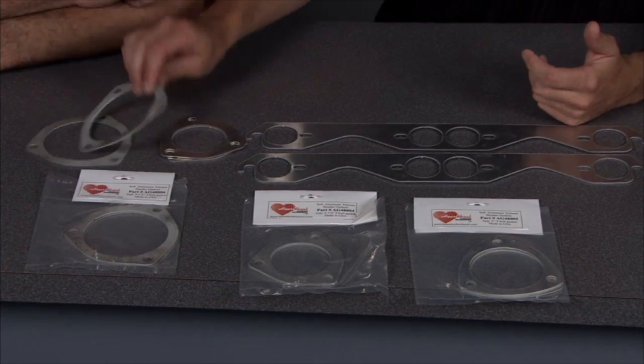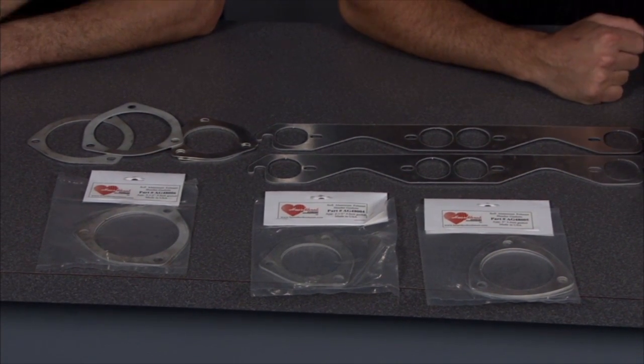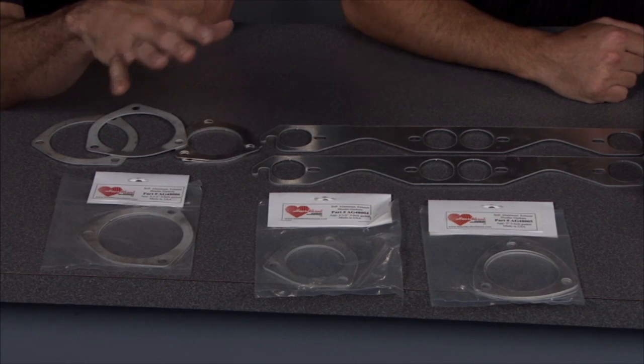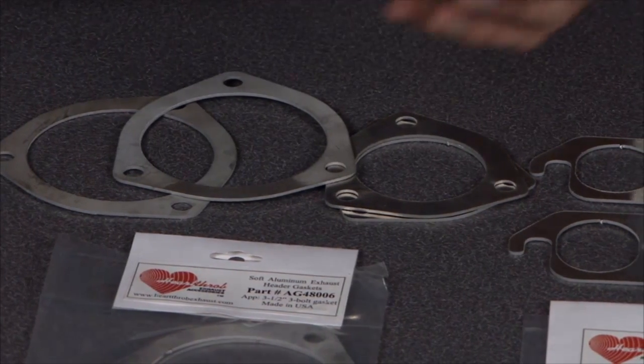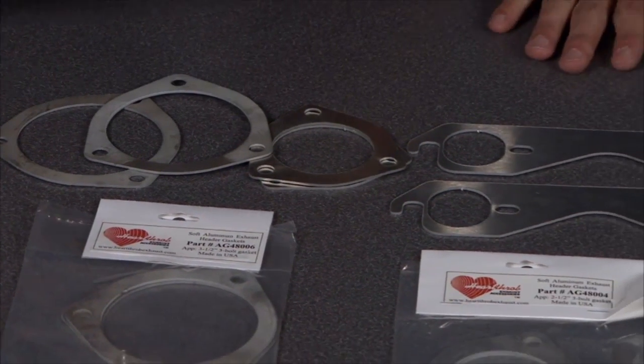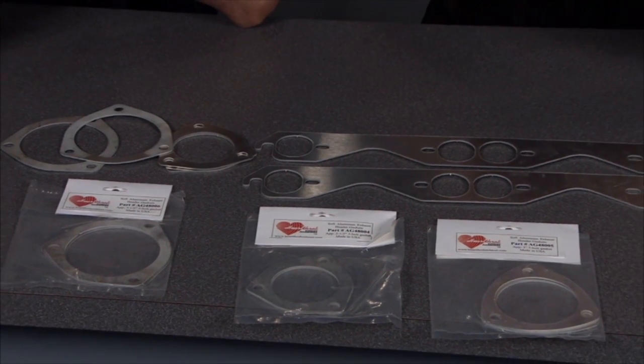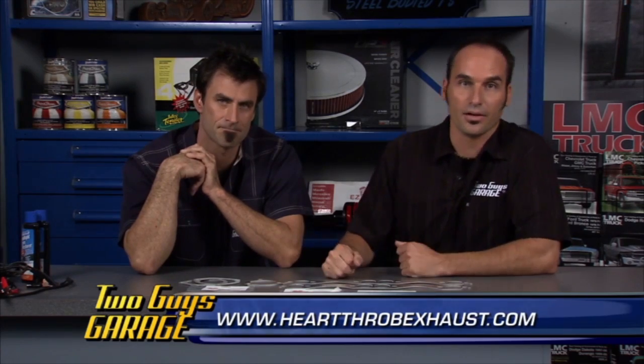Welcome to the break room — cool parts galore. We've got header gaskets from Heart Throb Exhaust Accessories for the head face and for the collectors. These come in pairs in 063 aluminum, dead soft, which is 3003. The nice thing about 3003 soft aluminum is that if you need to redo it, you can anneal them, make them soft again, reseal and reuse them. Uneven faces from both flanges can work their way in for a good seal. These things aren't going to deteriorate, shrink, or blow out on you.